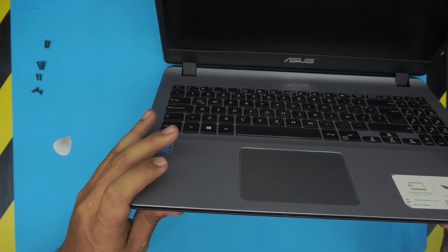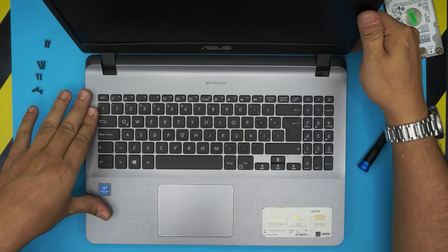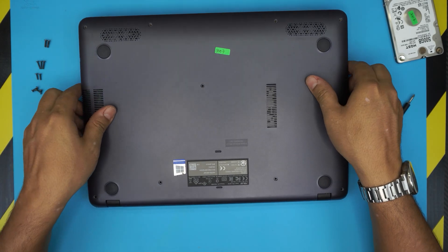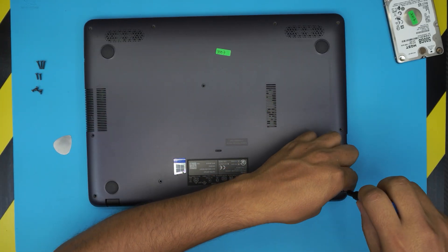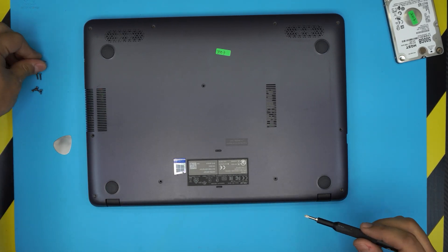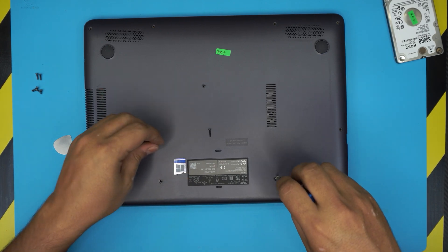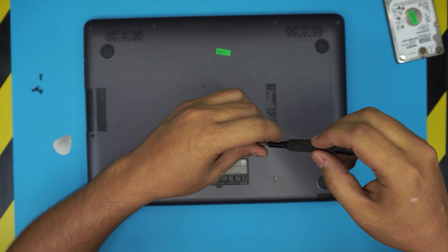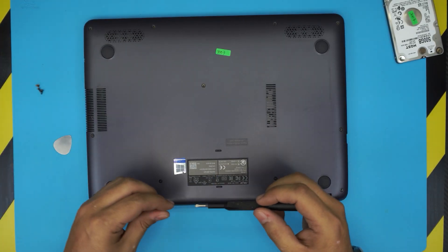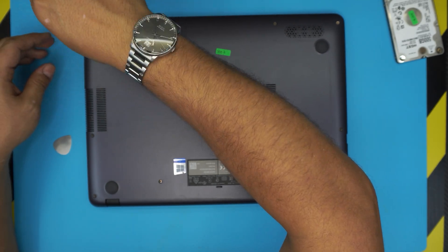Now close up the lid, pinch all the sides in front, push down the sides at the back, then close up the laptop and flip it over. We're gonna put all the screws back in: remember the two thick ones go in the corners by the hinges, the longest ones are the mid-triangle center screws, the medium-long ones are the corner ones, and the four short ones go in the front. Thanks for watching, guys — I really hope this video helped you out. If it did, click that thumbs up button, leave any requests or questions in the comments, and I'll see you in my next video!